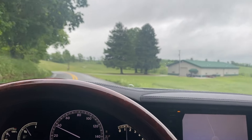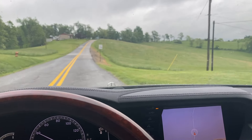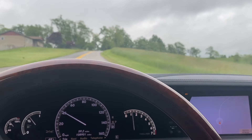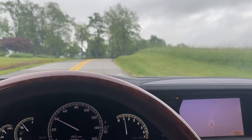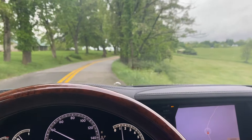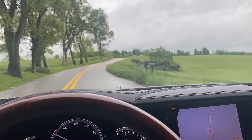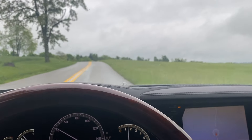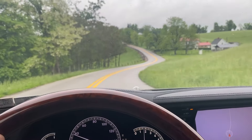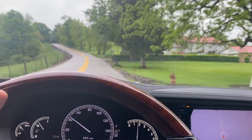There was also some deferred maintenance — most notably coolant and brake fluid. The brake fluid situation was really interesting; I've never seen this before. When I opened the bleeder on one of the rear wheels, this jelly goop came out. I've never seen anything like that before. It actually came out for a little while before actual fluid started coming through, and the fluid was pretty dark brown.